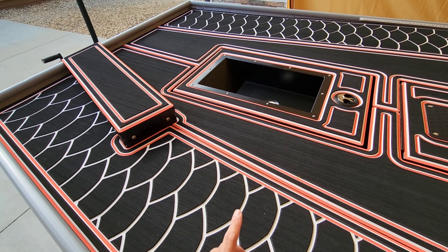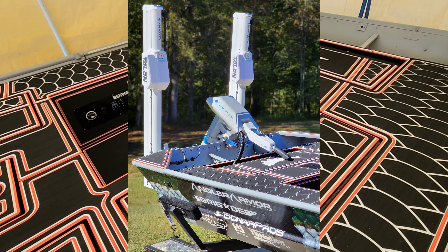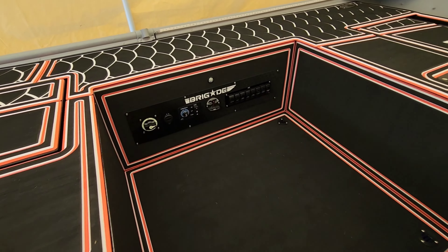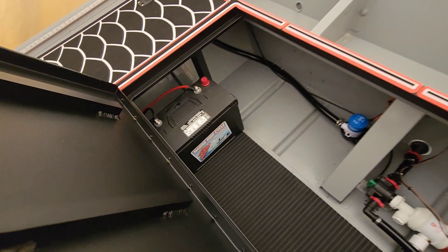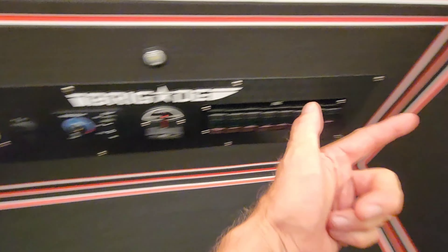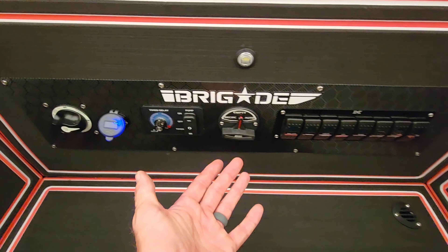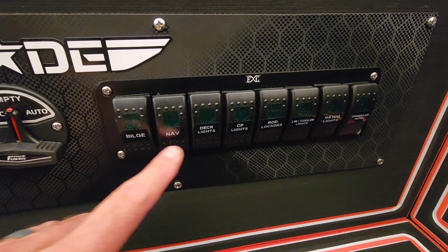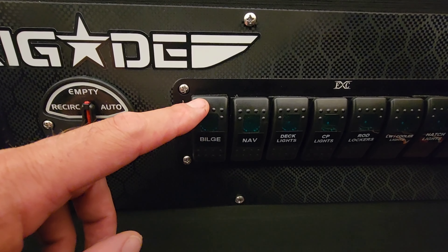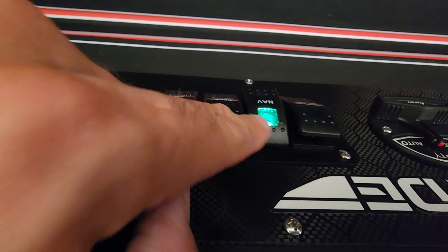She is a beauty. It's been about a week since we shot that last clip with the corner piece of decking removed doing all the final wiring into the fuse box and negative bus bar. This boat is heading to Sonar Pros for the trolling motor, foot pedal, graphs, batteries, and wiring harness. I was tasked with the main electronics package. First, hit the power switch — that now has power running to the fuse box behind the panel. Checking voltage: 13 volts. I also print out labels for my switches so my customer knows what is what.